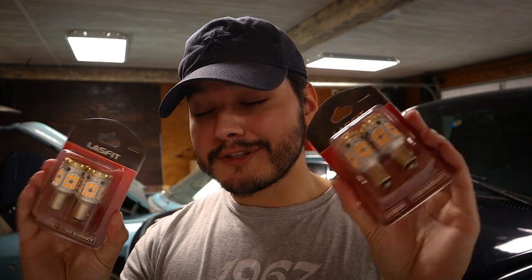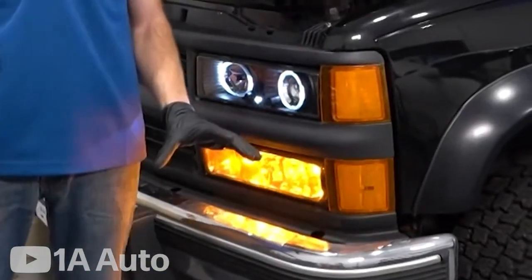I also got these replacements for the corner lights — basically a nice little LED upgrade. And I got these for the turn signals. You'll notice they're a little beefy and have some weight to them, because they have a resistor built in to combat hyperflash. Hyperflash is when you replace a halogen bulb with an LED — halogen bulbs require more power, so the LED gets too much power and flashes much quicker. These have the resistor built in so it's literally just a direct swap — pull out the old one, pop this one in, twist, and you're done. No hyperflash, but you get the LED brightness.